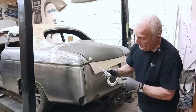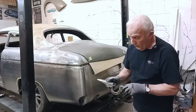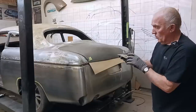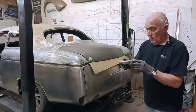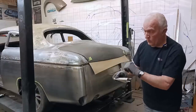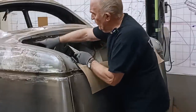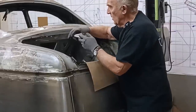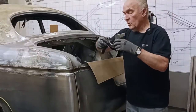To replace that ugly spring assembly, we're going to use gas cylinders that are so popular nowadays. They take up far less room and function a lot better. We'll cut openings so we can slide these in. They will be welded to the rear deck on the underside; the pin will be welded to the outside so the pin won't move — just a bushing will move on that pin. We've notched out the rear deck enough that we can slip the side cheeks in past that, giving us room in that slot for this arc to move back into.